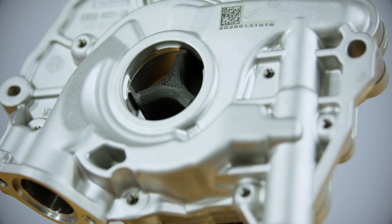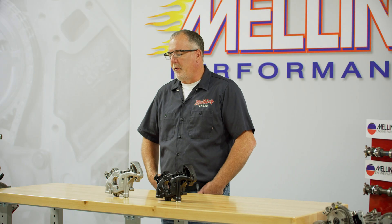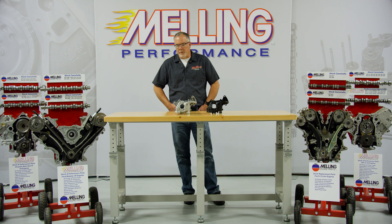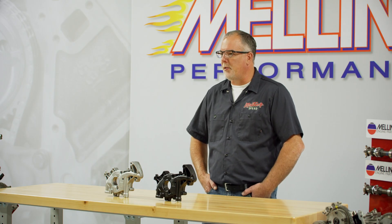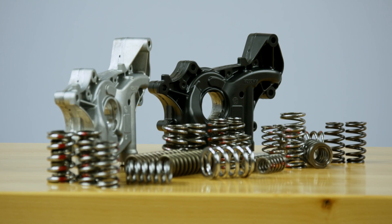We found that the EcoBoost engine shares a lot of the similarities with the modular engines, where the valve train really needs some additional volume. So we designed this pump — it's an increased volume of 20 percent, also a high pressure pump with a 100 pound bypass setting versus the factory 80 pound setting. We do include the spring to drop to the factory setting if that's desired.